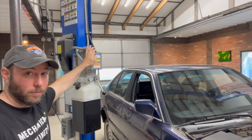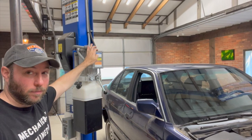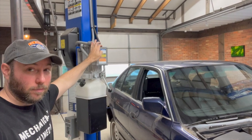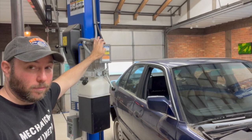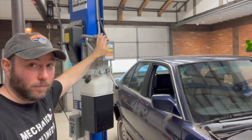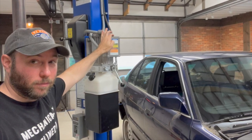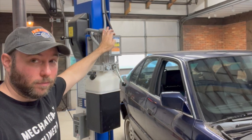Before we get to the best part, I just wanna pause here and tell you guys something. I wasn't able to capture on camera the process of loosening the front and rear subframe. The reason being, it was very sensitive. It was unsafe. I had to get under the car with it in that state on the ground with a whole bunch of tools. I had to be very sensitive and hyper aware of my surroundings. But to accomplish what you're about to see, basically all the subframe bolts had to come out. And I just had to be sure that all the elements were disconnected from the body of the car and all the weight on jack stands. So I hope you enjoy what you're about to see. It was a lot of work.